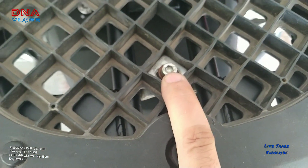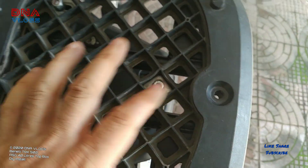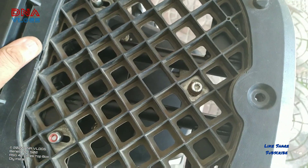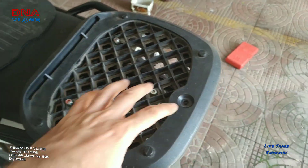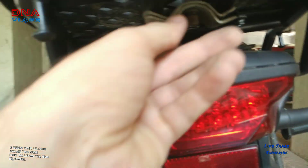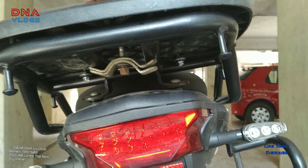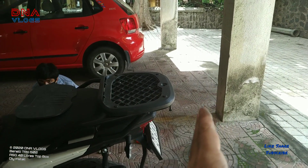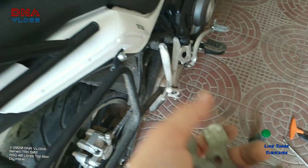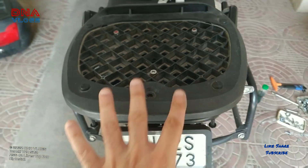The third nut and bolt set is also ready, again using the same slot washer. I've misplaced one so I only have three, but I don't need a fourth on the TRK because I don't see a place for installation. I've put one in horizontal and two are vertical — putting two horizontal and two vertical restricts the overall left and right movement of the top plate. I've also used two U-clamps from ASG at the bottom because all the weight is going to be on the second half, so I wanted it more secured. Different top racks will require different arrangements.